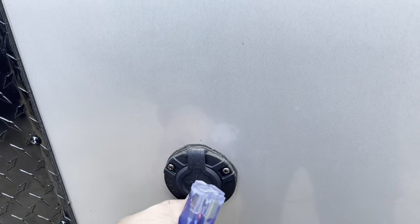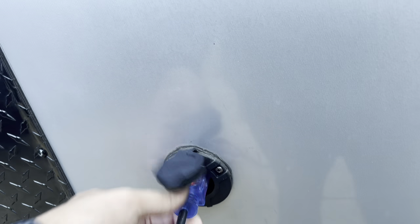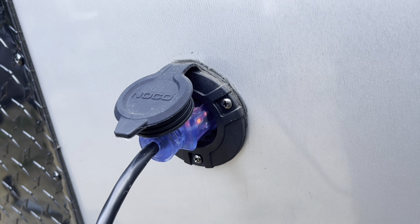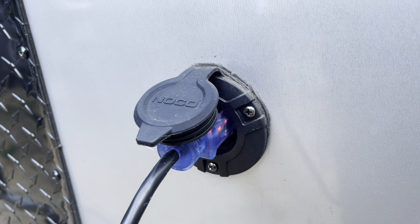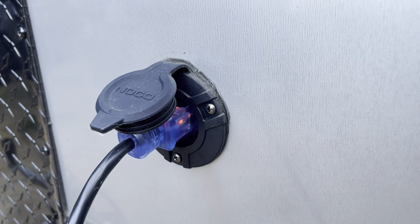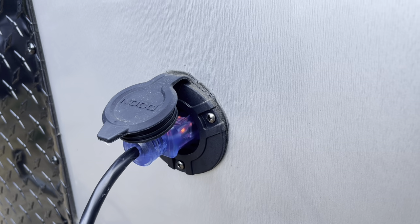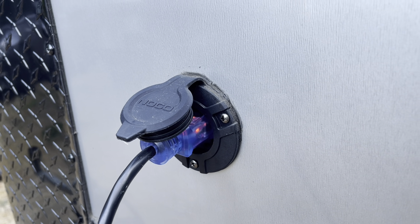Here is the port that goes all the way through the trailer, so when I plug this in it's hooked right up to that charger that is charging the battery as we speak. It's an automatic float charger, so I can just leave it plugged in all the time and it takes care of all our charging and battery maintenance needs — so the trailer is always ready to go. A little nerve-wracking punching a hole in the side of your trailer, but worth it.